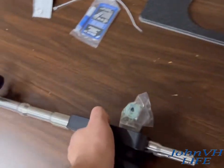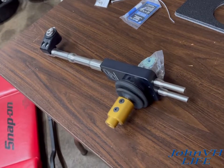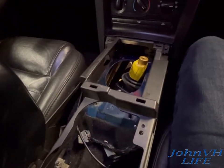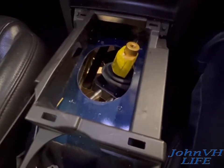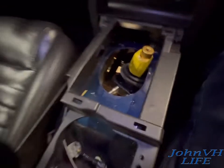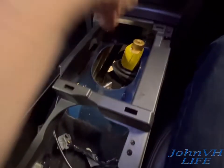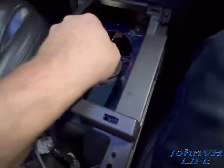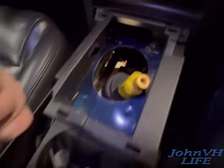It was kind of fun to weasel it around. I got underneath the car, pulled that arm to the side of the transmission and down to get a good angle, then you've got to fiddle around up in the car. The key is to get this part up through the hole and then go far enough forward to squeak the back through — I was about ready to cut that thing apart. Now we've got to reverse the process and fish the new shifter down in there. I taped up the gold part because you keep working it and you're gonna scratch your shifter — you're rubbing it on this metal hole which is not big enough.